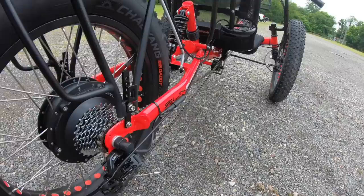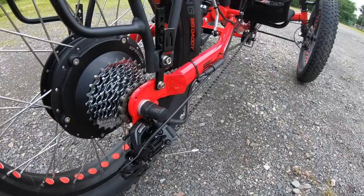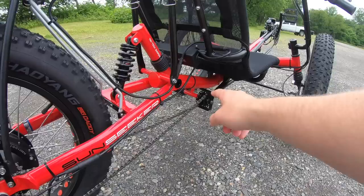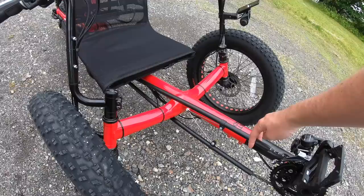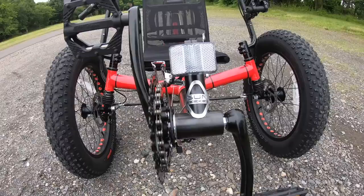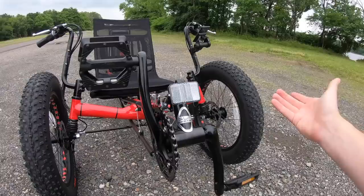The chain extends through the entire length of this trike. The total length is adjustable — at the bottom end it's about 77 and a quarter inches long, and extending the front chain ring adds another six inches or so. Following the chain, it comes up here, goes into a cross section that has little dummy wheels to keep it aligned and articulate with the shifter. They have tubing to keep it neat so you're not scuffing your pants. Then it comes up through to the front derailleur, which is a three-speed with 22, 32, and 42 teeth.